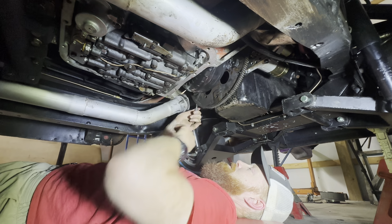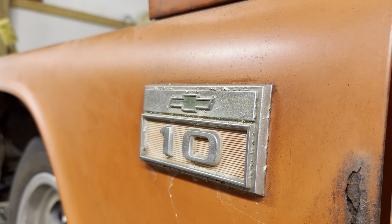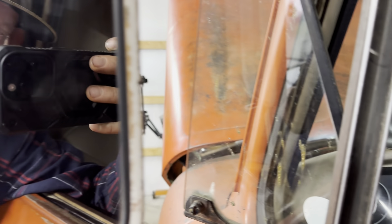I'm putting just a little bit of blue Loctite on the torque converter bolts because the last thing I want is those coming flying out of there. I'm also putting a washer in between to take up some of the spacing — there's about a quarter-inch gap, so I've got about an eighth-inch washer in here to get the final gap to about an eighth of an inch when it pulls up. I've heard that's the rule of thumb, and that's how I did it last time.